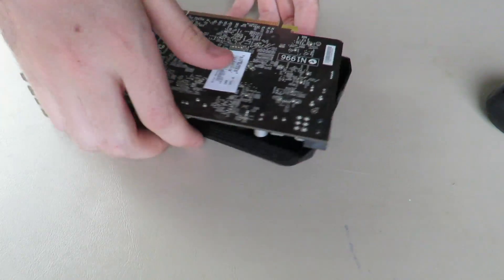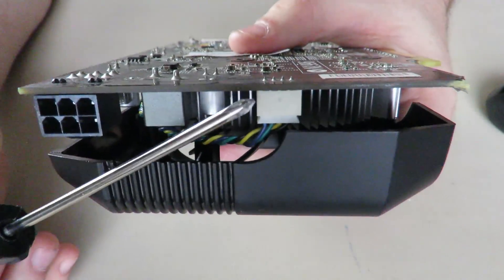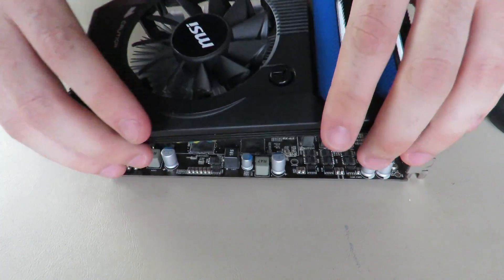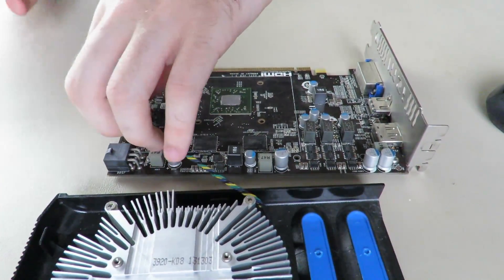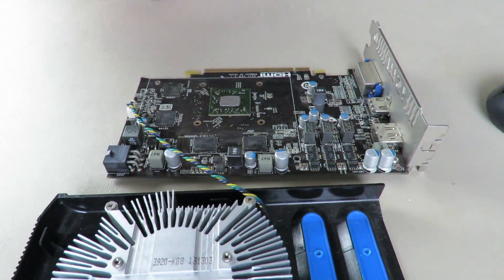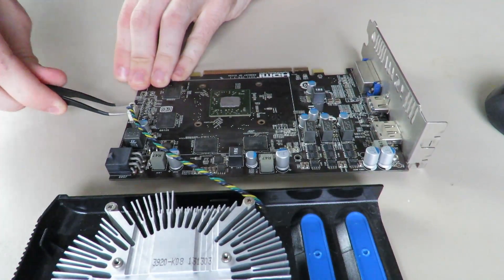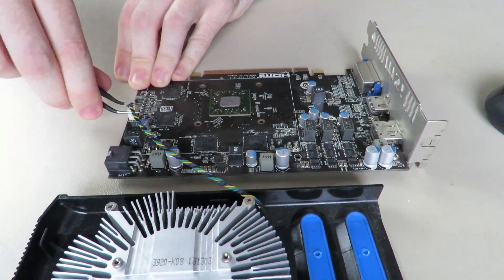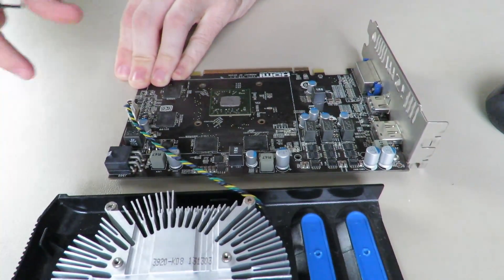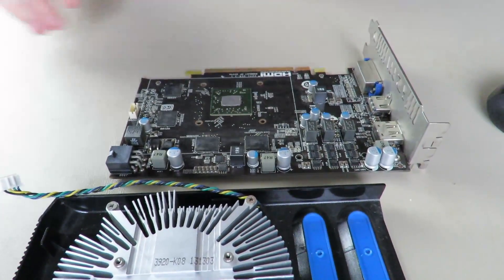There's not going to be a lot of screws in this. Your fan header is actually right there, just so you can see it. What you're going to want to do is flip the GPU back on its other side, take it off, and lay it on its side. Then what I like to do is take my small tweezers and just slowly but surely work that header out. It may be tedious and annoying, but this ensures the best way that you're not going to break that cooler.